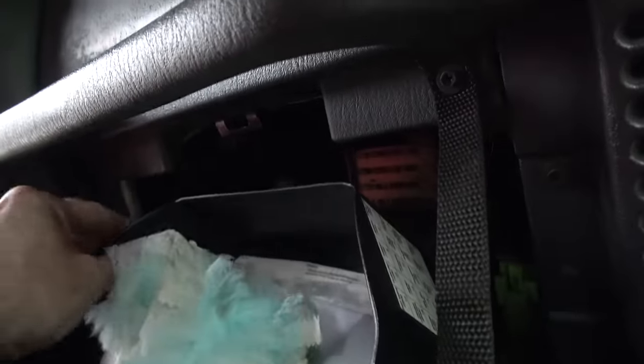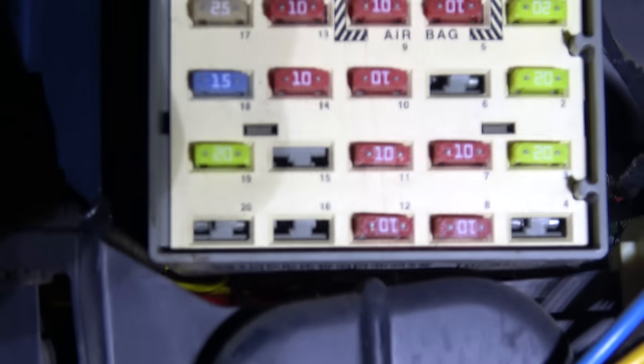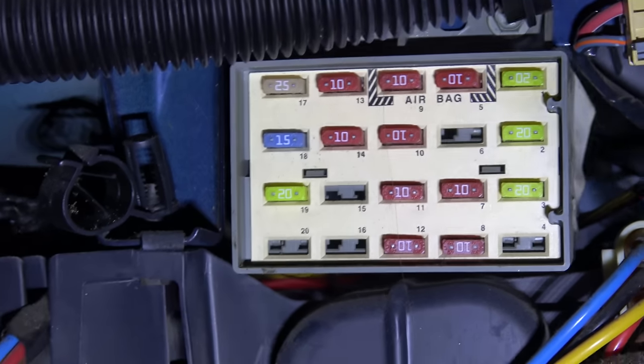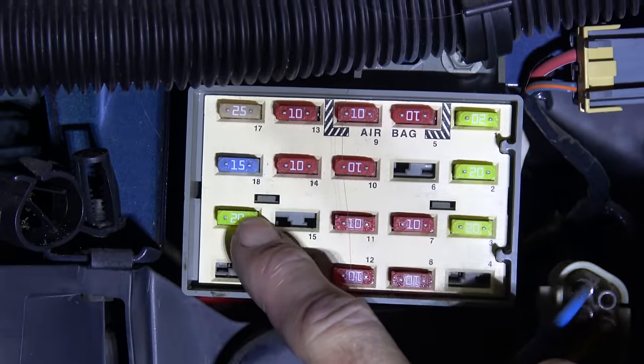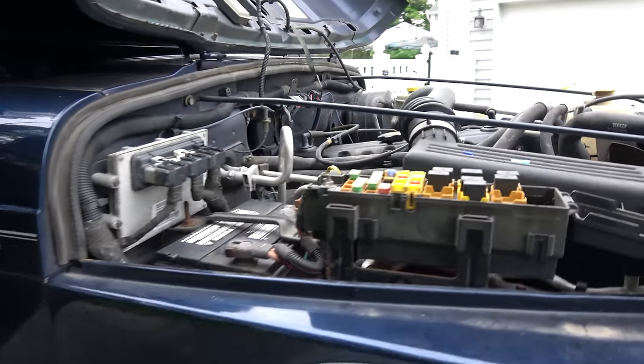Keeping in mind, at the Target parking lot I did not have a multimeter, so my ability to assess what's going on was pretty limited. I actually bought a hammer to see if that would help. In the fuse box behind the glove box, in the lower right-hand corner at fuse position number 20, you can put a fuse in there and it will basically bypass the clutch safety switch. I took a fuse and just put it down there to see if that made a difference — it did not make a difference. That's where I got stuck.